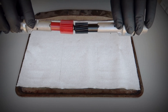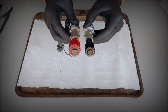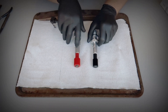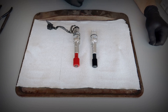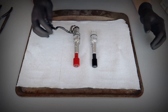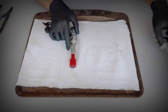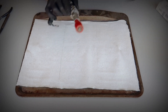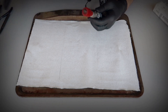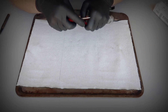As you can see here, this is why we're switching the red over to where the black was. Not only is it larger but it has more teeth. The red one is what actually comes out of the RB25 from the factory. This black one here is what we're gonna be losing — we're just gonna be utilizing the housing of that sensor. So the first thing you need to do is go ahead and pop off the circlip or C-clip, whatever you want to call it.